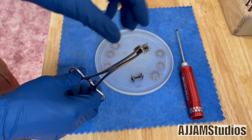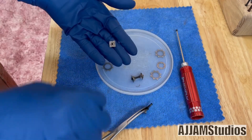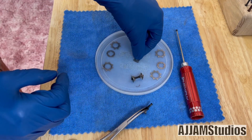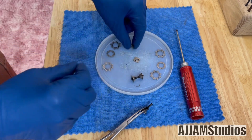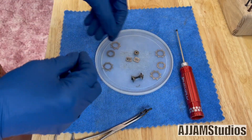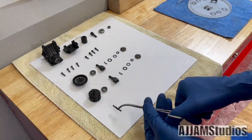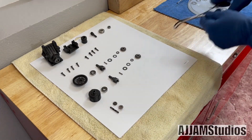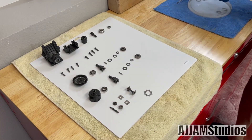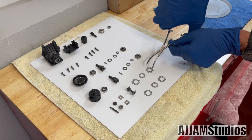For the planetaries, take a look at the little perforations in the shims — that's actually part of the LSD system. You've got one shim and one gear; take a look at the back of the gear — it's got little slots on it, also part of the LSD system. There's a completely built one, and then your star gears — or star shims — your singular round shims, and your star shims.